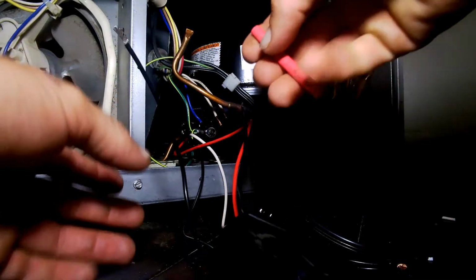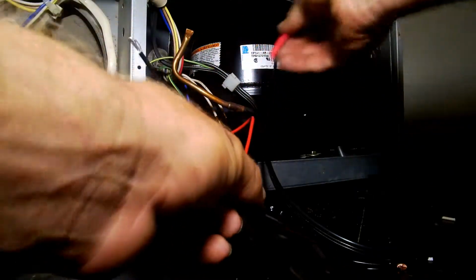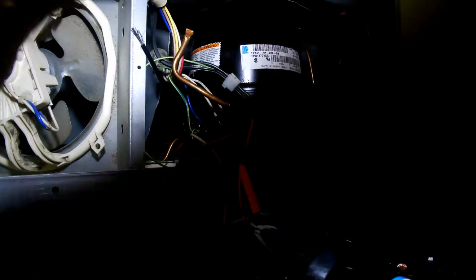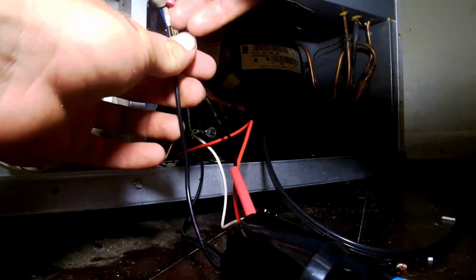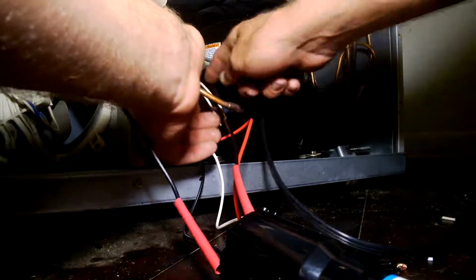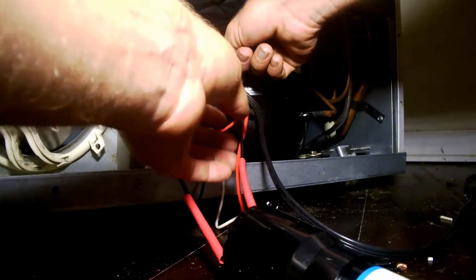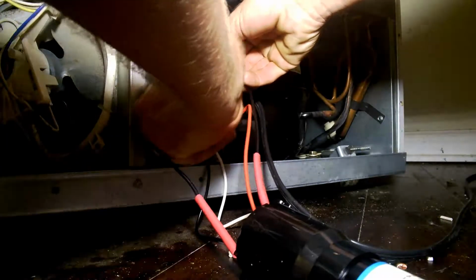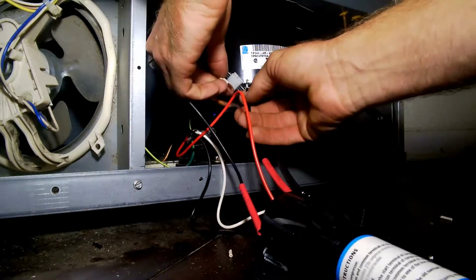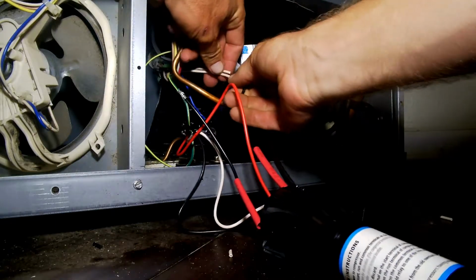If you choose to go the extra mile and do the heat shrink and solder and all, make sure you put your heat shrink tube on before you go putting wires together. One here, one on there, because you're making two connections. And then over here, if you're paying attention when I cut the wires, these two stay together on one side and that one goes to the other side. So we'll come over here and work on getting them twisted together just so.